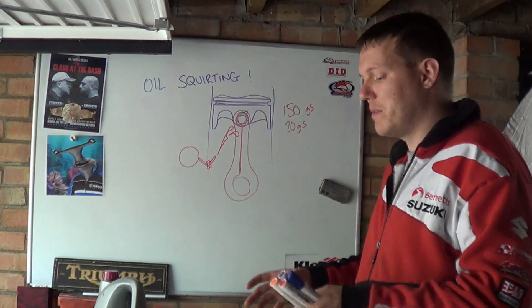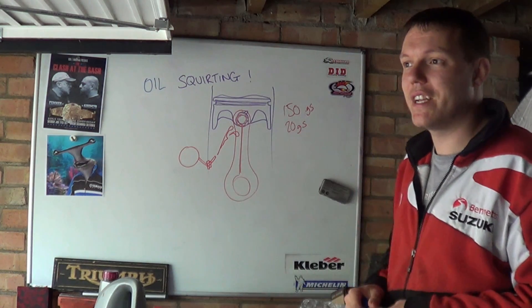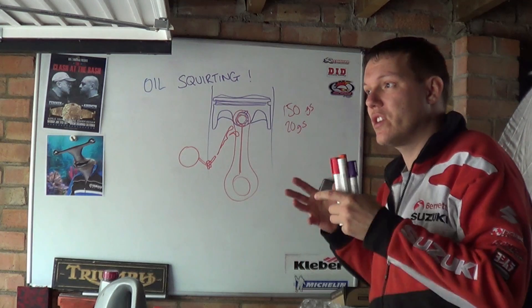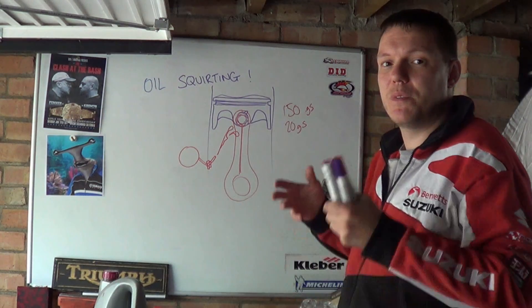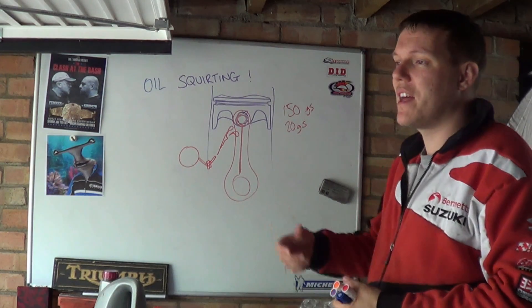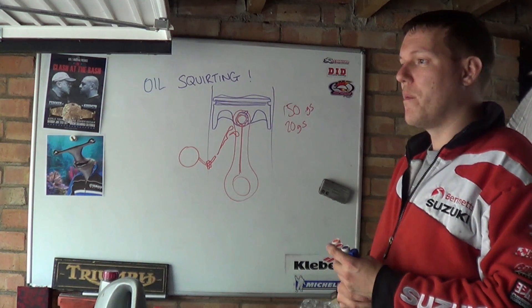So that's oil squirters. You might see when you take your cylinder and pistons out of your engine, all these little pipes facing up at you and go, what the hell are them? That's these little oil squirter jets — this is what they do and this is why they're important. They're there basically to lubricate things, but the main reason why they're there is to actually aid in the cooling of the underside of the pistons. Obviously it makes sense for high performance engines — you're running them faster and faster, which means more and more heat, more waste heat, and you need to remove that otherwise the engine is going to start to suffer mechanically, and you get knock and so on. So that's what they're for — I hope that makes sense, and I'll see you in a bit.